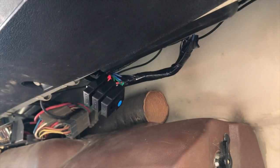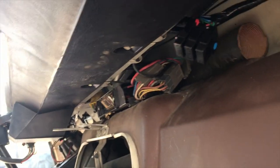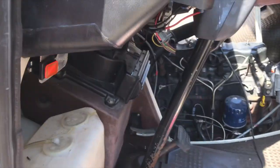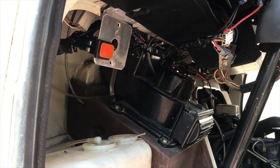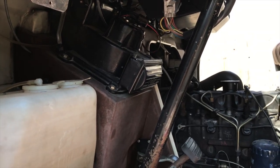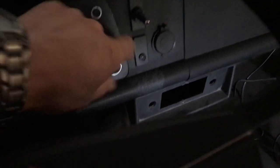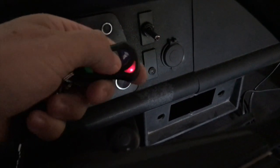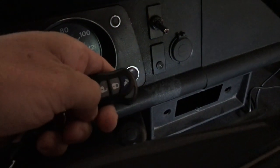Let me show you around — there's the fuses for the alarm, we've got the control unit tucked away up the top there, ultrasonics coming in and wired up either side on the top. We've brought all the wiring across through the top of the dash, and I've tidied up all the ignition wiring. Looking pretty good — I'm pleased with that. I've just found a nice blank switch base — drilled an eight-millimetre hole through it, and then when you press the alarm system now to lock it down, the light comes on. Beautiful — glowing nicely.